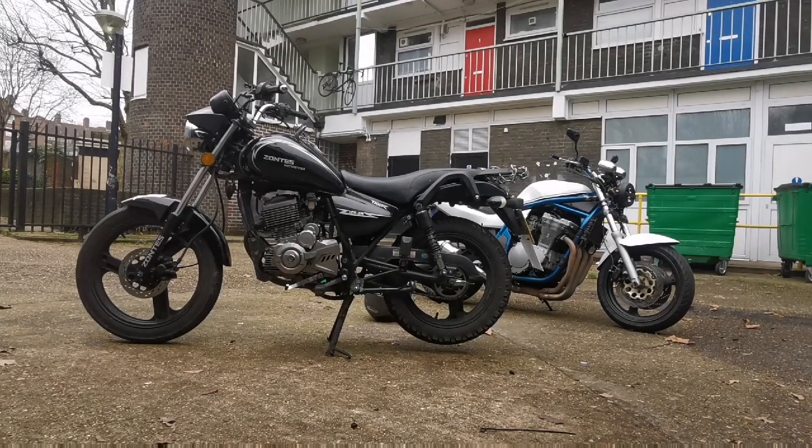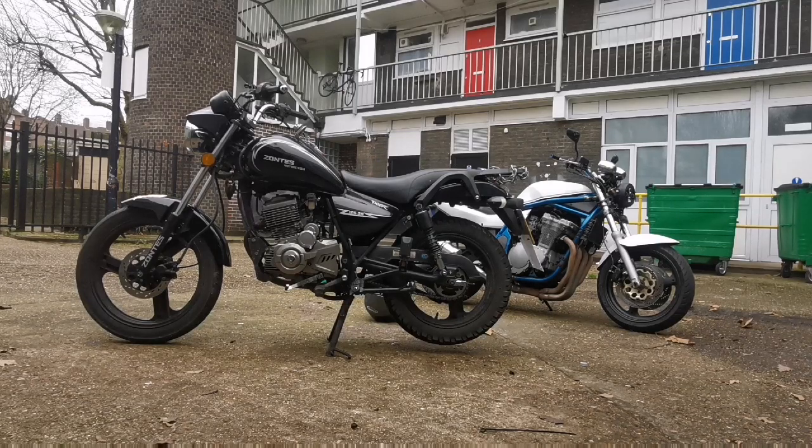Okay guys, I've kind of done as much as I can do on this one. I flushed the tank, cleaned it out as much as I could. It was terrible. The rust was rattling in there. Gone back to the straight pipe, drained the fuel out of the carb, drained the tank, like I said. Now I'm just throwing fresh fuel in and it should go back to normal.